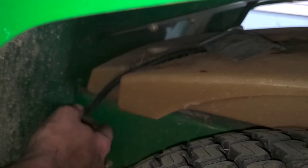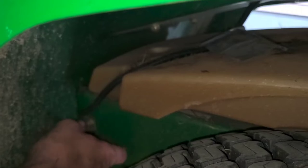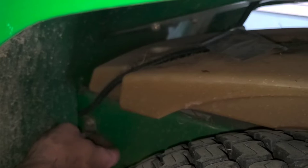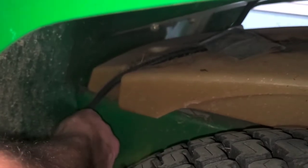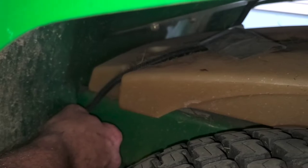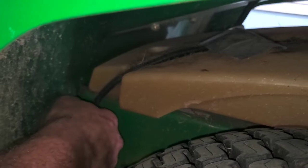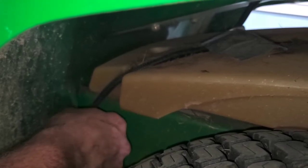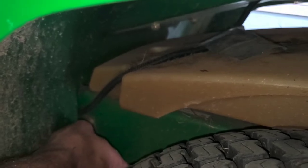And you wanna make sure you don't get anything in them when you're doing this. You know, if you're trying to go through a place where there's a lot of grass or anything like that up through here, you wanna clean that grass out first. Because if you're trying to go through all that, some of that's gonna get in that line. We haven't installed the filter yet. It's not gonna get on the wrong side of the filter, hopefully, but still, you want as little as you possibly can as far as particulates in your fuel line, for obvious reasons.